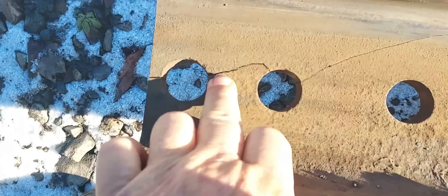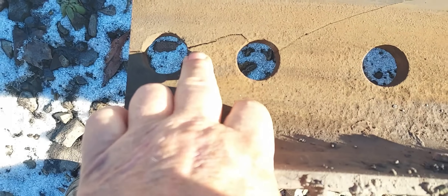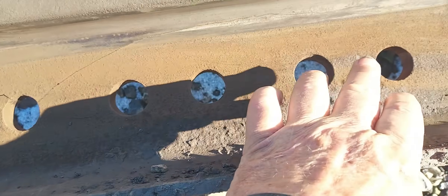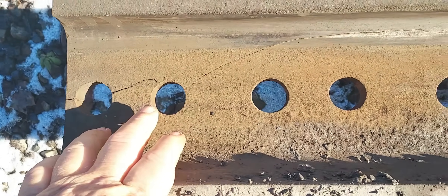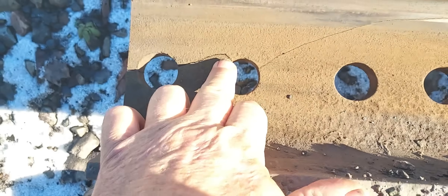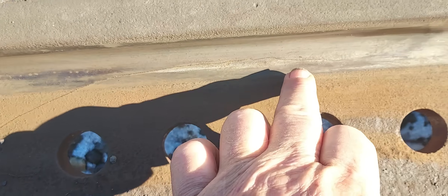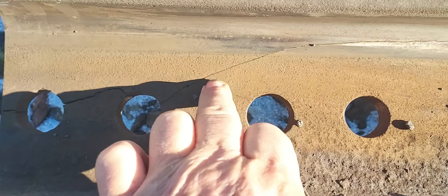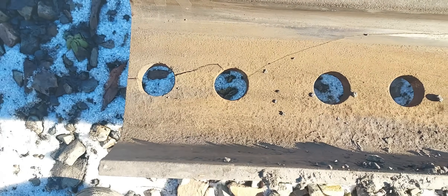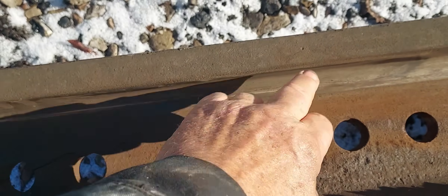I wanted to get you a much better picture of this. This is typically called a bolt hole crack — a crack between your bolt holes. And there are extra holes in here too; I have no idea why they're drilled like this — it didn't come from the factory. But as I said, this would typically be called a bolt hole crack. You can see this crack going up through there, and that's why they call it a head and web separation. Very good thing we found this. There's no doubt that at some point in the future, this head would have blown off.